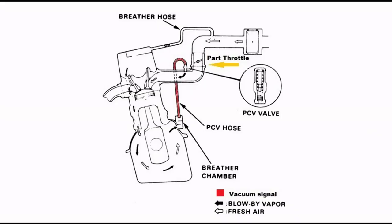Now as the throttle plate is closed, at idle up to even part throttle, the air demand of the engine is far greater than what the throttle plate allows. Therefore, it creates vacuum. And that's when the PCV valve lets crankcase evacuation happen, which is a good thing